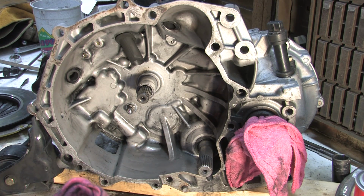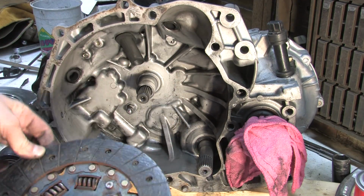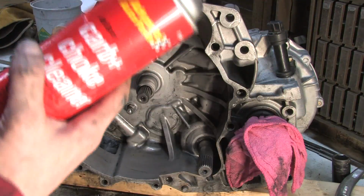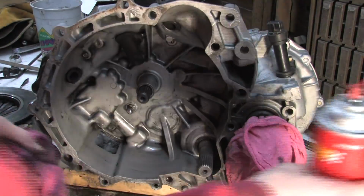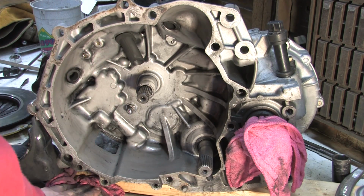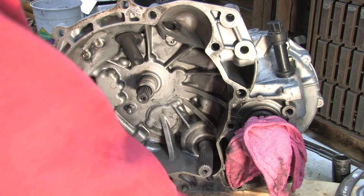Great. Well, the reason why I didn't use compressed air on this, the clutch discs often have asbestos. It's not really good to breathe that stuff, so you want to try to use a liquid solvent that'll keep the stuff from becoming airborne, and that's what's best for your lungs. So while it might be hazardous to breathe in the fumes from that stuff, it certainly beats asbestos or mesothelioma.